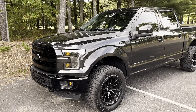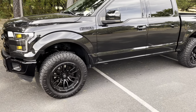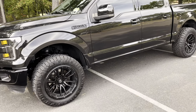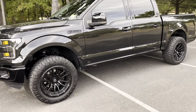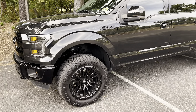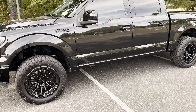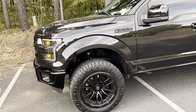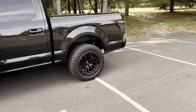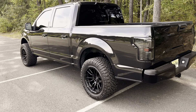As for future modifications, there are only a few more things I'd like to do. I'm going to be doing a refresh of the brakes — getting some new pads and rotors. These have 68,000 miles on them and there's still plenty of life, but I just want to clean it up and get some fresh rotors and pads on there. They're really not expensive at all. Also, to make this truck ride as smooth and nice as possible, I decided to do a suspension upgrade. I'm not going to do a lift kit, coilovers, or any crazy Fox or King setup. I'm just going to be upgrading the struts to Bilstein 5100s on the front and rear, which will make this truck ride much smoother and feel like new.